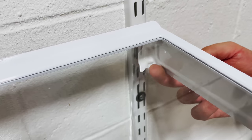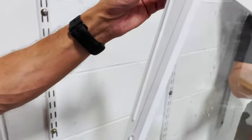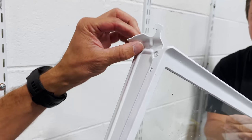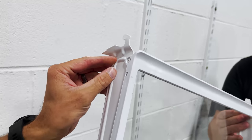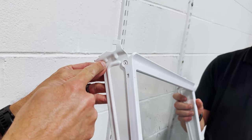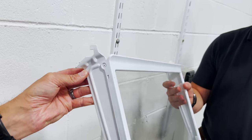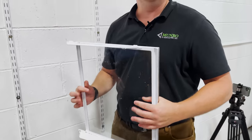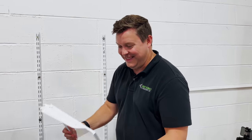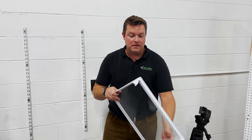It stopped at the gusset. So it actually bent in between the gusset geometry. So you've got, this stayed fairly rigid, but it bent along this curve. So if the gusset was possibly continuous from there to there, you might have actually been able to support that. Now the biggest shock of all of this is that I bought way too much milk. I thought we were gonna be able to stack a lot more up on these than what it held.